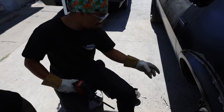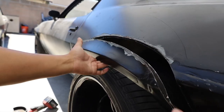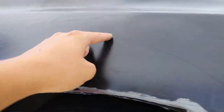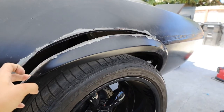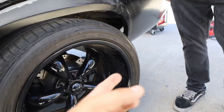Grisha's worried about road debris, so we have to explain real quick. We're gonna cut - this is just so we can see how far it comes out this way. What we're gonna do is cut up here because this is where the flare is gonna start. You can see there's two skins - there's the inner skin right there. We're gonna cut the inner skin and pretty much weld it to the back side of the quarter panel on the inside, so the inner skin is way up here and he has all that clearance now. Then we're gonna put the tires on, sit it down, let some air out the back of the air shocks, and see how much we want to pull this out.